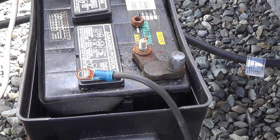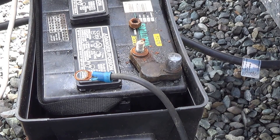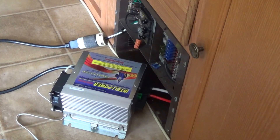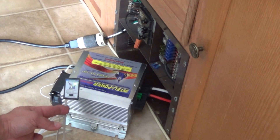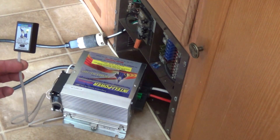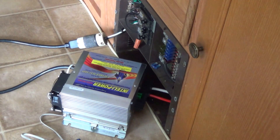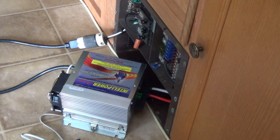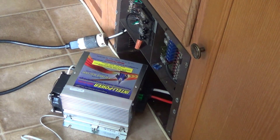This poor battery has been cooked to death and at least I'm going to get an opportunity to clean this cable up a little bit before I hook it back together, which might help performance too. I put a meter on my battery and it's only at about 10.5 volts. The little wizard pendant is telling me we're on full boost mode, so it's trying to charge that battery up. I've got a pretty good suspicion that battery might be done for, but I was thinking about swapping it out with a couple of 6 volts anyway.